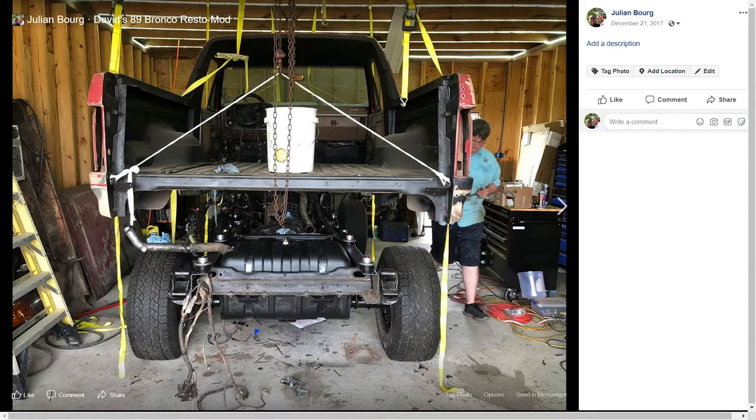Right here you can see the F-250's fuel filler neck. The hose that goes into the tank is not an extremely common part and would have taken a while to source. We needed to get the body set down, so it's been rubber-taped very tightly because there was a tiny tear in it, with a pair of hose clamps over the top — and it's never leaked. The diesel filler neck is also necessary; otherwise you can't fit the diesel pump nozzle into it. I've actually heard of guys doing diesel conversions and forgetting this part entirely.